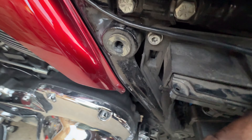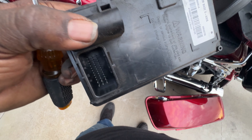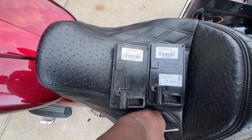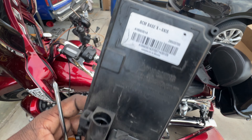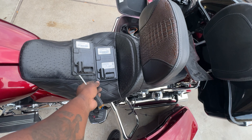This is the retaining clip for the BCM, and that shit just slides out like that. This is definitely easier with two hands or a tripod — but you see, lift this up, pull it out. We got this one off. As you can see, it is simply the exact same thing — one says BCM Security X and one says BCM Base X. Let's see if I can put the old one on eBay and get some money for it; it's got to be worth something. Installation is the reverse of removal.